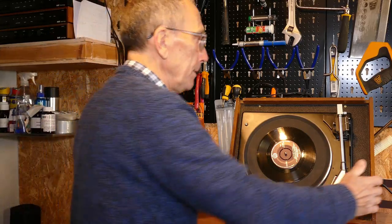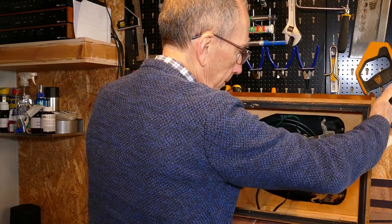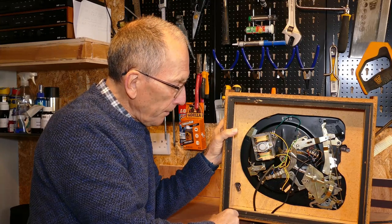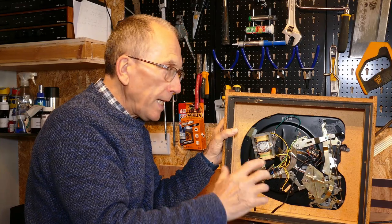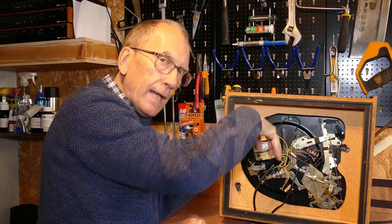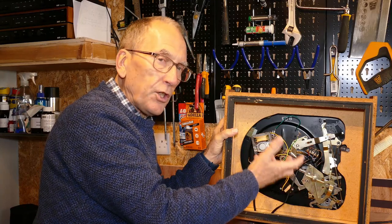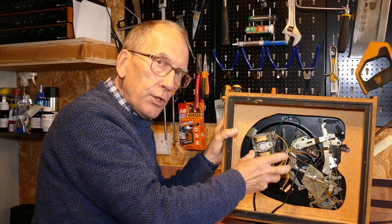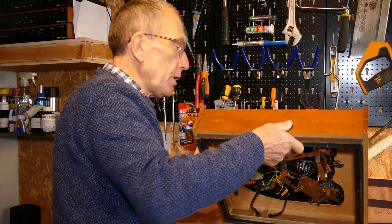What makes that happen is that lot there — the motor and then a lot of mechanical linkages and so on. As we'll see when we start getting into taking this apart to service it, there's more mechanics underneath the platter. There's grease that they used on here which through lack of use solidifies and just jams everything up, so one of the main things we're going to have to do is try and free everything up.